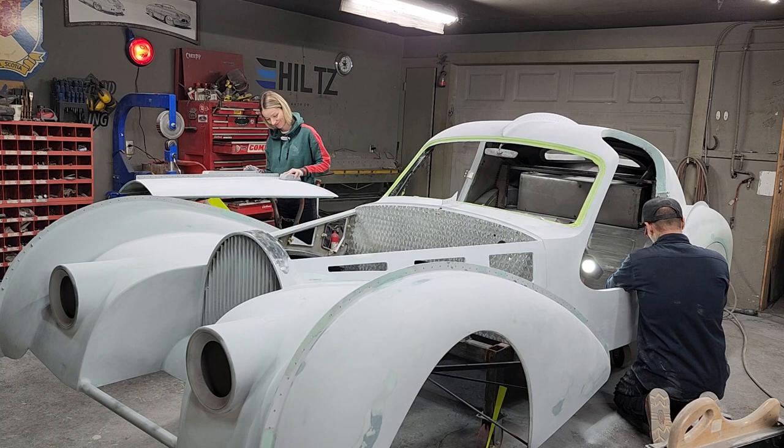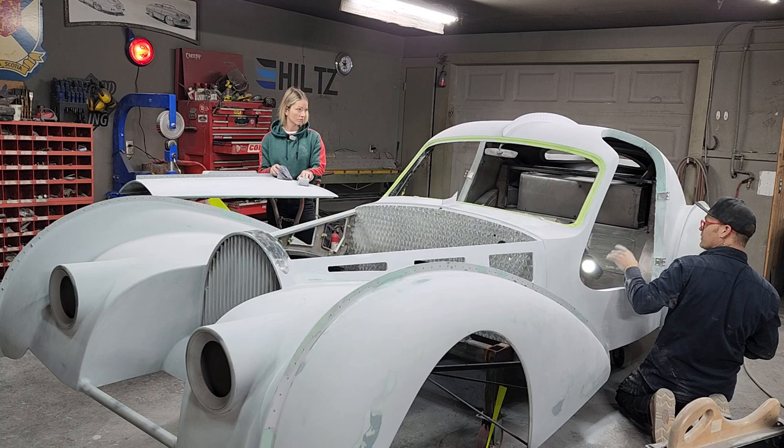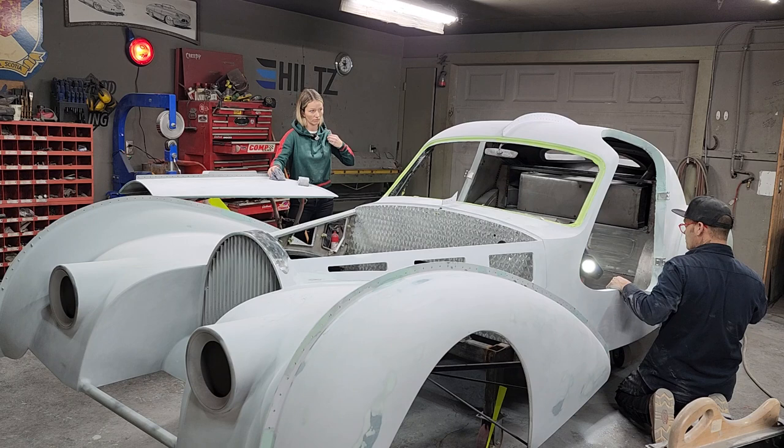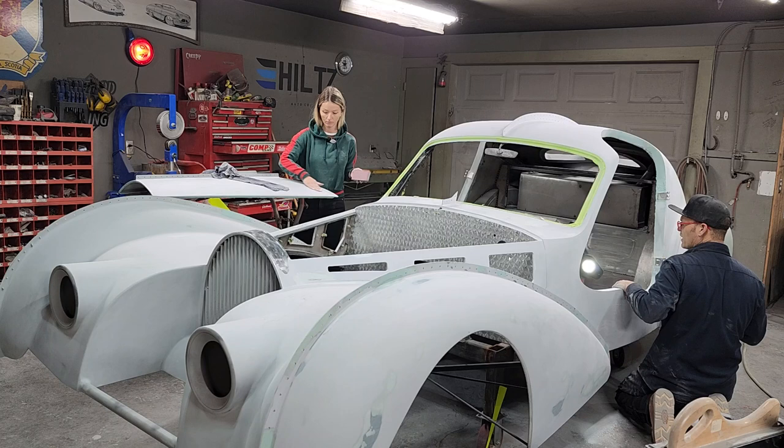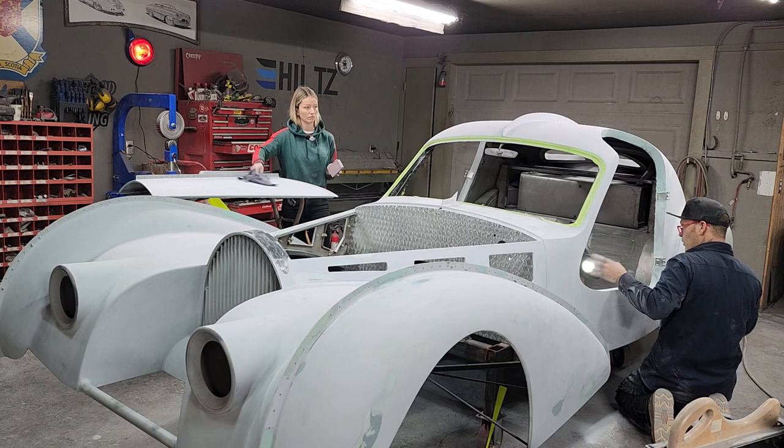We're thinking, or I'm thinking, I might paint the car and not put the rivets in it. And if anything looks not right, just put a couple coats on it, see if it looks good, because it is sort of necessary that it looks good. Then put the rivets in, sand it down with, say, a 400, 600, epoxy the rivets, and then paint it one more time for good. I'm thinking I might do it that way, I'm not sure.